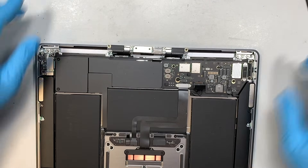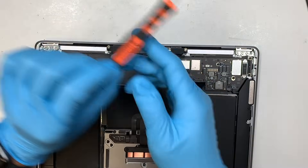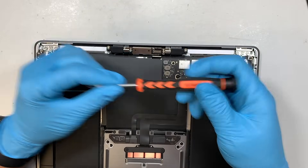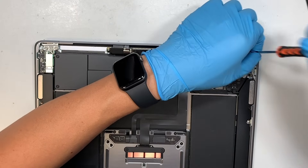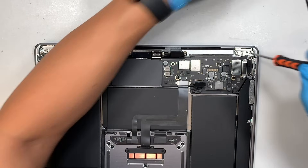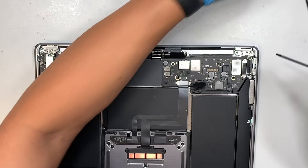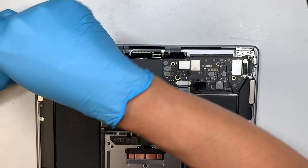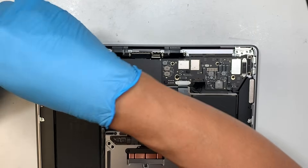The adhesive is somewhat glued onto the Wi-Fi antenna — it's okay to put some pressure to pry it open. That little metal bracket is taped or glued into the metal bracket, and that's the only thing you need to remove. Once that's done, move on to the T8 screwdriver — the Torx T8. We are removing three screws on both sides holding down the LCD hinge.